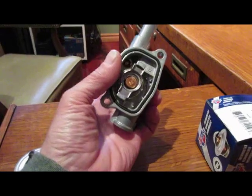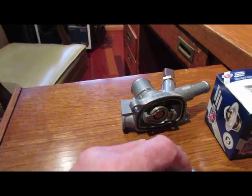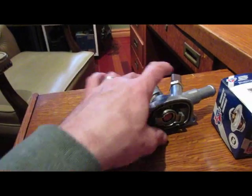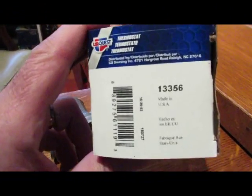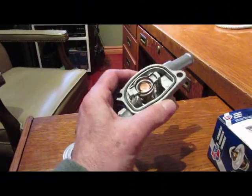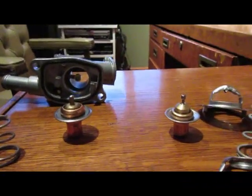The problem is it doesn't have airflow over it, so I'd like that engine to run a little cooler. What we found at CarQuest was this thermal pellet type thermostat - it looks very close. This here just spins out. Here's the part number. That CarQuest part was a $5 part Canadian, compared to $34 Canadian for the Rock Auto unit with the temperature sensor. A little bit of experimentation and we'll see what we get.